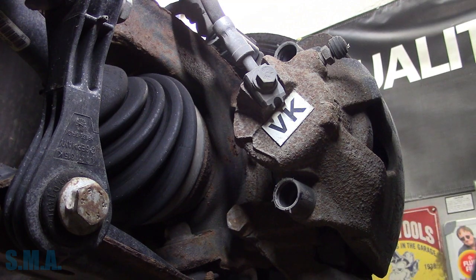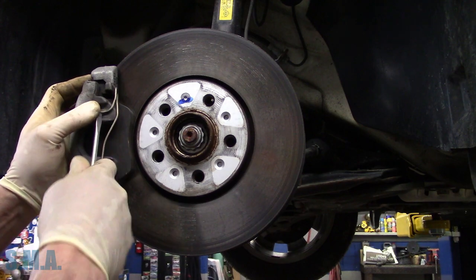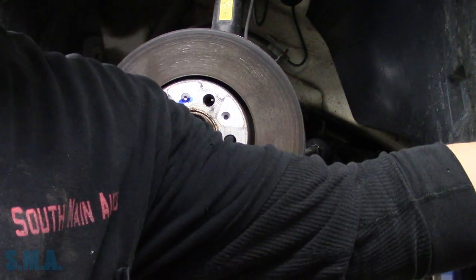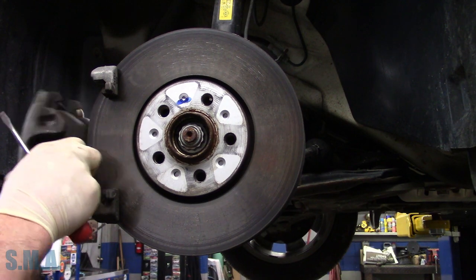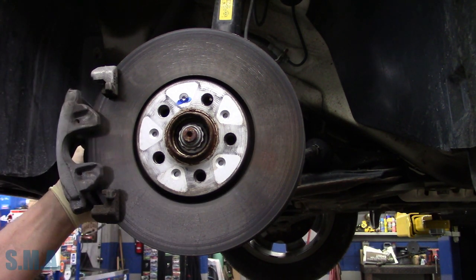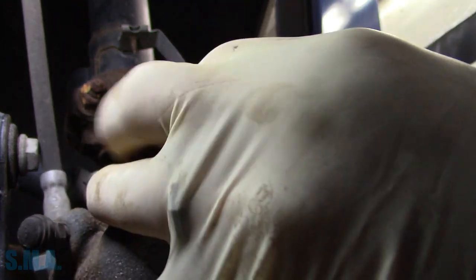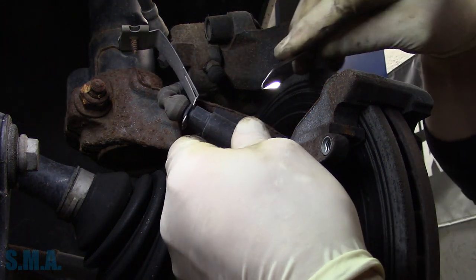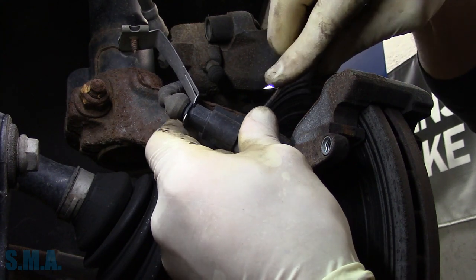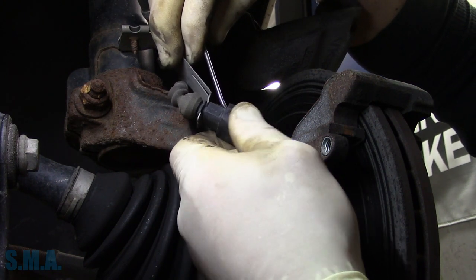Get both of them out of there. On the outside here there's this fancy little clip — pop this off. If you've done brakes on a Jeep or a Chrysler, they're almost 100% identical to this. And we just wiggle the caliper off. Then we'll take this pad off — we forgot to unplug it like a ding-dong. You always got to remember to unplug your brake pads. So we're going to pop the pad and leave it dangling. Then we've got to figure out the connector — you push in a little bit and then release, or reach up underneath and get the release tab.